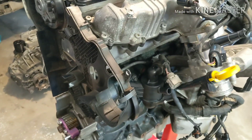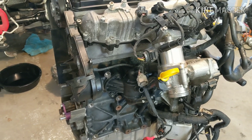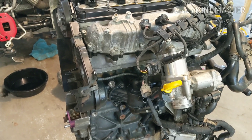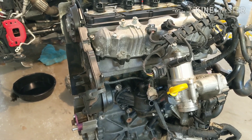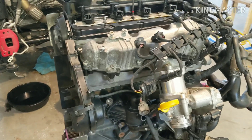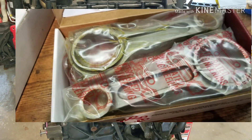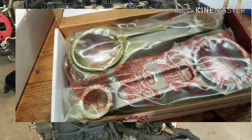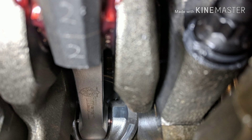I've been considering going a different route with the turbo. Back to the rebuild — the engine shop inspected and polished the crank. It's all new main bearings, rod bearings, and I went with the KS sputter bearings, which are maybe a little tougher. I also have Integrated Engineering Tuscan connecting rods. They clearanced everything and checked the wrist pins to make sure everything is good there. I appreciate the local engine shop, Barrel Engine in Green Bay, Wisconsin, for helping me with that.